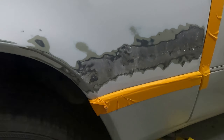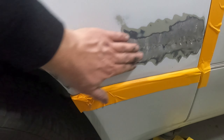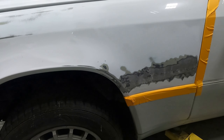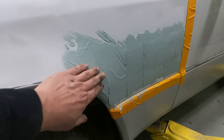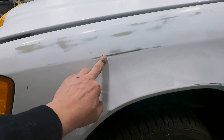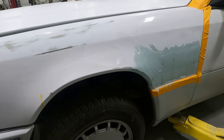Let's get some body filler on there. We got this sanded back, and we'll sand back the yellow paint too — it's just a marker for the windshield. We're putting some body filler on this now. This area is taped off and sanded back — you always want to scuff up the area around it. If you don't, it won't stick and it will delaminate over time. Mix up some body filler and slap it on. Now it's all hard, so we're going to sand that back — use the DA real quick, then feather it out and sand back by hand. Hopefully this will only need one more final coat after that, and we can fine tune it and get some paint on this old girl.